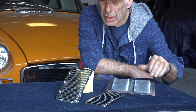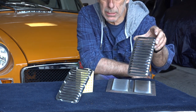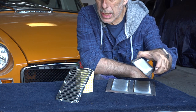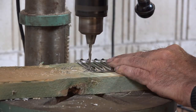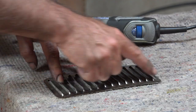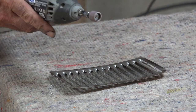All you need to do is get an inox piece from an HVAC store — that's your louvre. I didn't have a single piece in the store so I cut one in two, ending up with this panel as you can see. I cut it out and then started to drill some holes and round off the edges. Now I'm going to use a die grinder to clean it even further because I don't want any sharp edges on this.